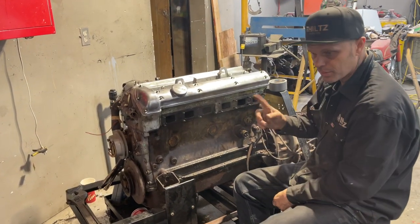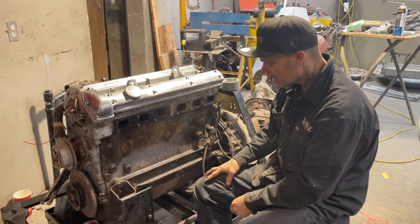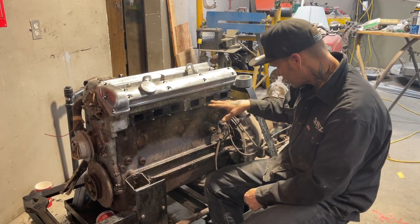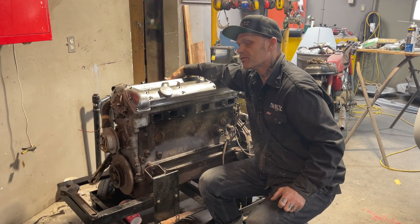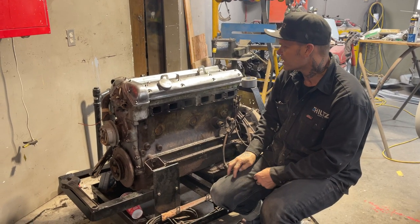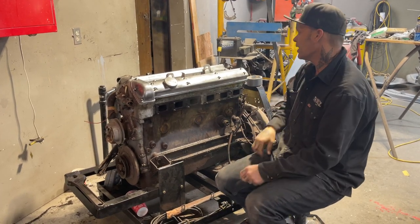I've used the Crown penetrating fluid to do everything. I'm thinking that the penetrant did its job, because every stem and cylinder in this car looks good in the exhaust ports. I can't see on the fuel side, but on the exhaust side, it really looks good. I took some time last night and cleaned up inside there, spraying with penetrant and wiping with my fingers, trying to blow out whatever I could.